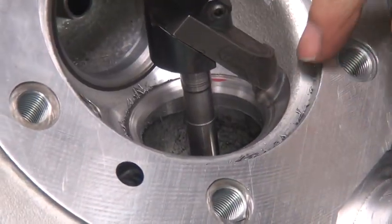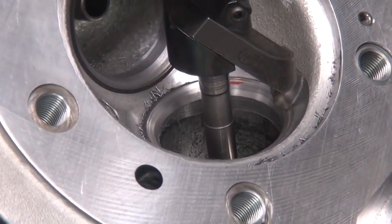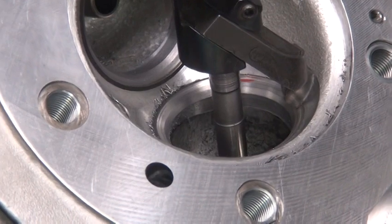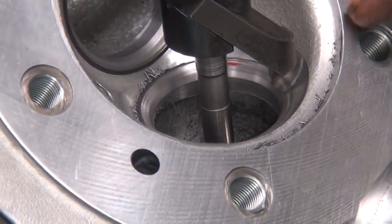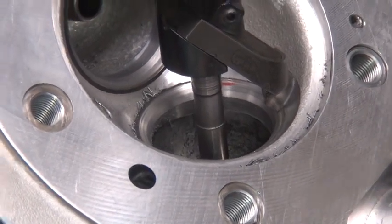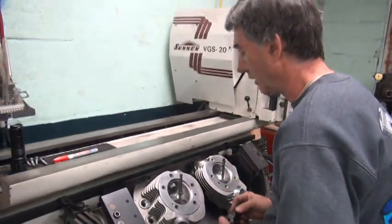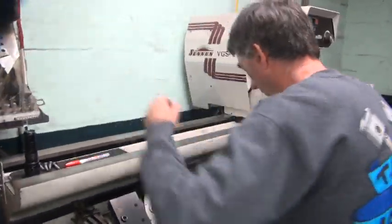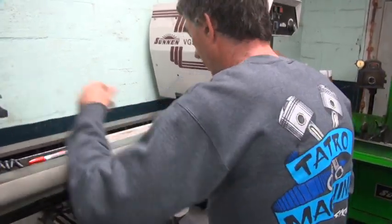So see how much metal is not here? That would be here if you use my cutter. That's just all lost compression, because of what they use. And this cutter flows good air. Having that extra cutout is actually a negative, because it's like having to go through a big dip in the road to get around your valve. It slows you down. The air doesn't want to be moving around. It wants to go nice and straight like a funnel, not go over dips in the road.